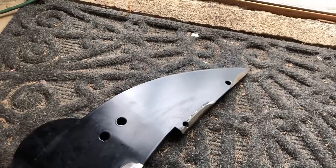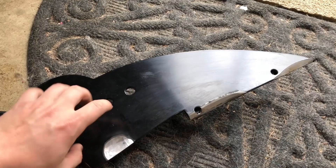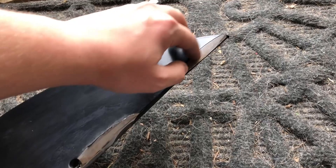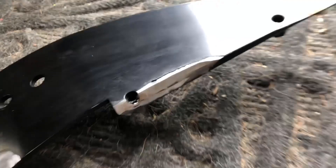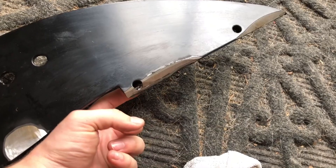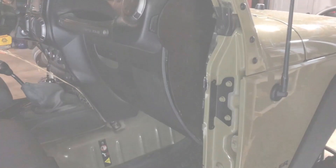I decided to trim a little on the Jeep casting and also on the cage, since the cage is replaceable. You can see where I've ground it down to make this thinner on the bottom parts and in the middle — though it's still super thick there because there's a plate. Didn't get into any threads. You can kind of see where it was scraping, so that shows you where to grind. Might have to do it on the driver's side too.